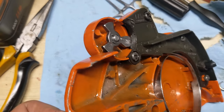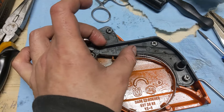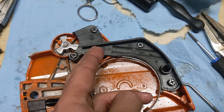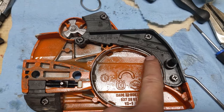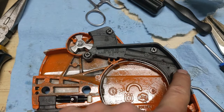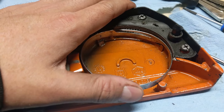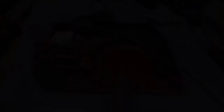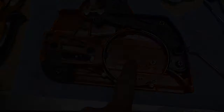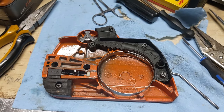We're back on the workbench now. We can see that the arm has been pushed down, so we know that gear now rotates, which dropped that arm into position. As this arm came down from the cog, that little bracket compressed the spring, setting it into the loaded or disengaged position. When your chain brake is disengaged, the spring is actually loaded — which is why you want to have this plastic cover on there; you don't want that spring shooting out and hurting you. The steel band has popped out a bit — that's okay. We can push this back in until it fits, and now you can see the difference in diameter. With a drum, we'd be able to put it inside of here.